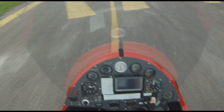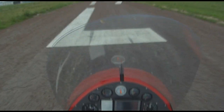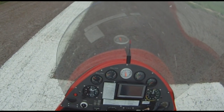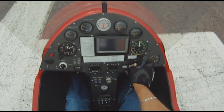We're going to slowly throttle it and get the rotation of the rotor going up to approximately 200 RPM in the MTO. When that's done, you'll notice the engine RPM will be coming up to 3,000. The rotor RPM is getting close to 200. Then I will go ahead and start initiating the takeoff.